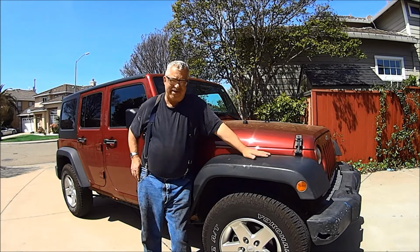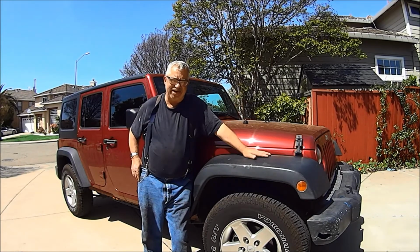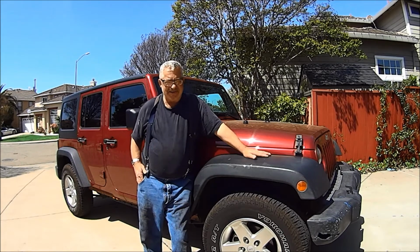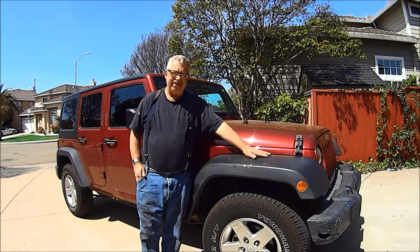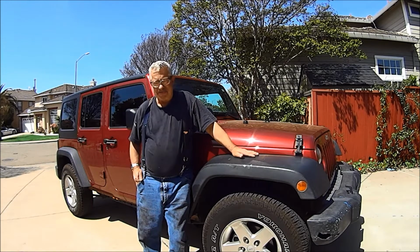Okay, so the road test went great. The brakes worked perfectly. I made 3 or 4 or 5 emergency stops. Everything worked okay. I even tested the anti-lock brakes. You know how you do that? Well, you find something loose: dirt, gravel, grass, and you have to be doing more than 25 miles an hour and slam on your brakes. And when you do, you'll notice the pedal will go about halfway to the floor. It's the first time it ever happens to you. It kind of scares you, but that's when the anti-lock brakes take over.